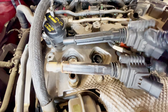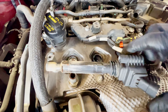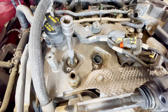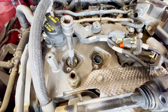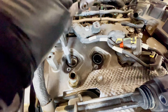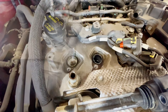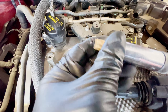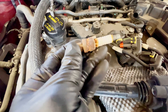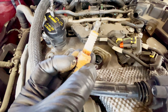As you can see, the number one cylinder coil is different than number two — there's some kind of residue, some kind of electrical arc. And once I pull out the spark plug you're going to see it's the same too — that's from electrical arcing on the spark plug tube.